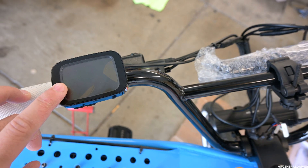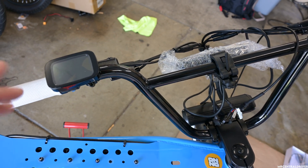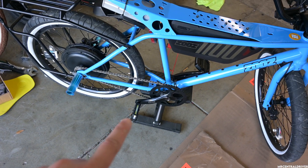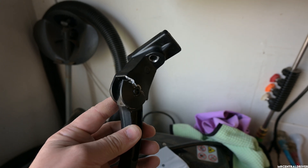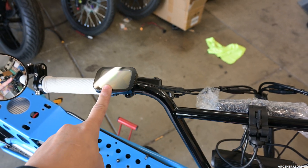When you're testing this bike and doing the auto-tuning, make sure you do not have your kickstand down. If the wheel rotates backwards, your pedals are going to rotate too, and that's how I broke my kickstand. My kickstand is completely broken and it actually bent the metal underneath the bike.